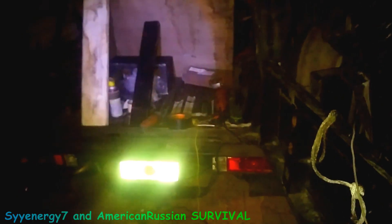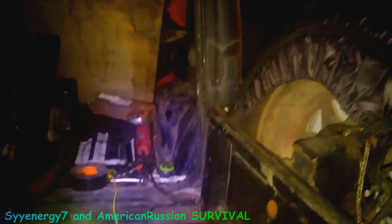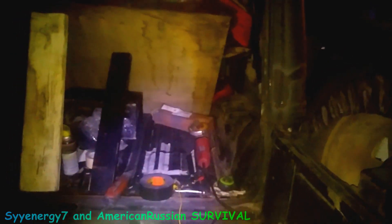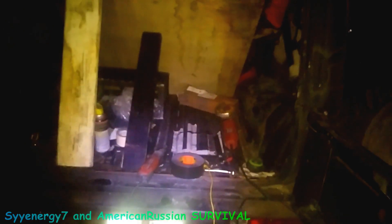Plug in the trailer, works fine, everything works - that would never have happened if I didn't do that. That's why some people ask why I'm being so nitpicky - because it lasts forever. Pay attention to the hints I throw in these videos. If you have a butt connector crimped together, there's always a spot where water can get in and corrode the copper wire - seal them up with weatherstrip adhesive or Shoe Goo. Those connections have been in there 25 years. After I start messing with the cannon I'm going to get under the El Camino and probably pull off the catalytic converter and knock a hole through it so it's a flow-through - it was making crazy noises. Maybe not the correct way, but it'll be the way that stays fixed.